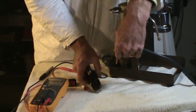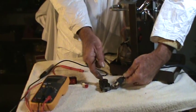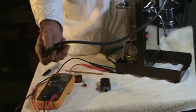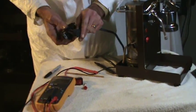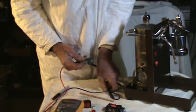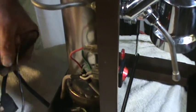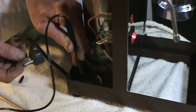To identify this, you start your wiring from your wall back into your machine. You take the long slot — that's the neutral. Make sure it is the neutral. Using your multi tester, you can very easily follow: put your tester, checking for continuity on ohms, on what you have determined to be the neutral side. There's the long slot, that should be the neutral side. You can test this to verify it by using your multi tester and checking if there's a junction box down in the chassis, which is very easy to verify. And once you take off the top, let's just verify to make sure that that's the case. Yes, we have continuity.